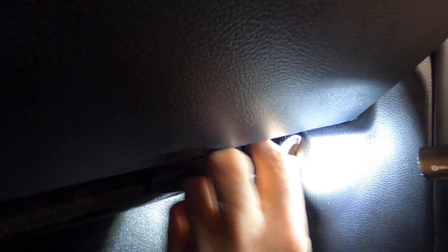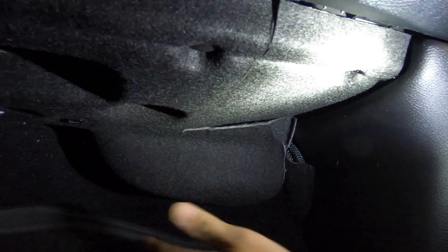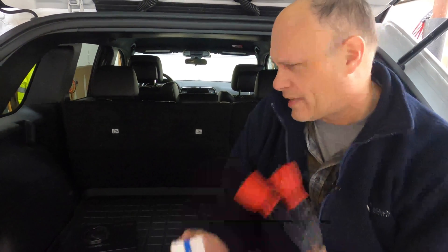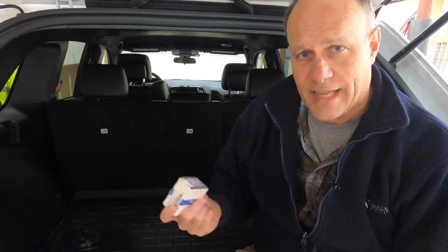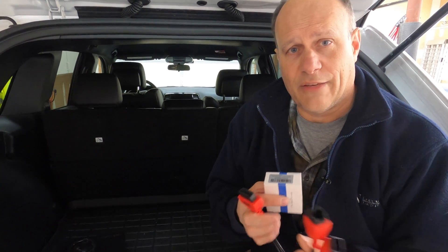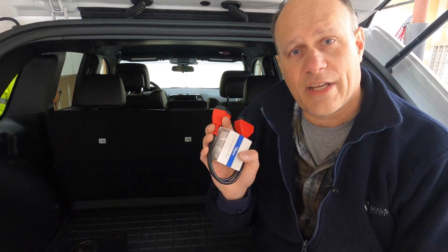Okay, that's one, that's two, this has got to go behind this cover - and that is three. Problem solved! We used our bypass cable and our communication tool. The cable is $20, the adapter is $29, and I had to buy a license for this specific vehicle based on the VIN code. So for $82 we solved the problem, and I have the ability to make any changes I need for larger tires, axle ratio changes, anything. I'm going to hang on to this stuff and use it for the next project. Thanks for watching.